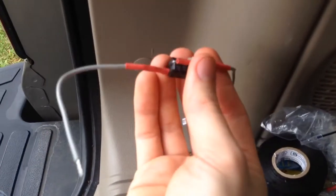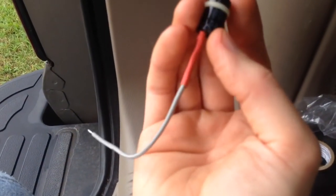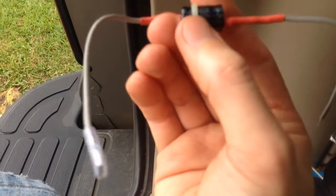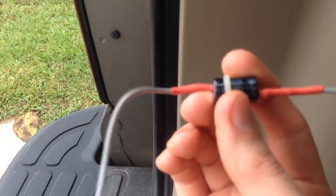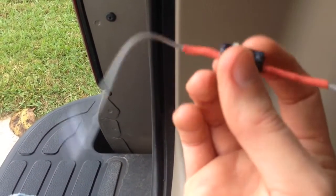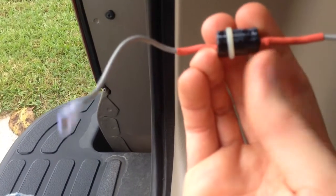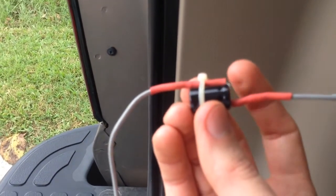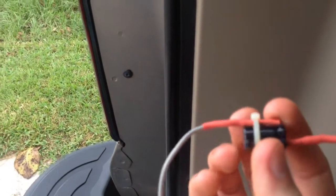We're going to clip these ends off of these wires, and we will wire up our speaker leads. I made some bass blockers with the speaker leads here. This is a 47 microfarad capacitor, 100 volt. I was actually looking for a 50, but couldn't find one, at least at the local store. All I had was 47, and these are non-polarized, by the way, so positive and negative are on either side. It doesn't matter. Most capacitors have a positive side and a negative side. This one doesn't. You can do it either way.